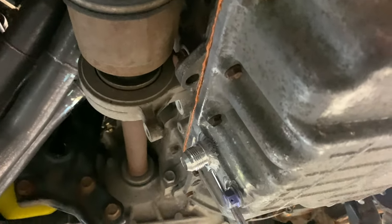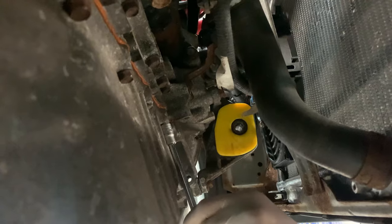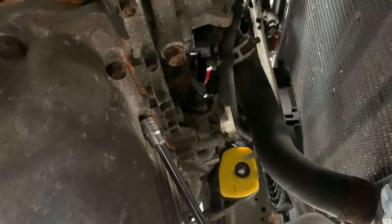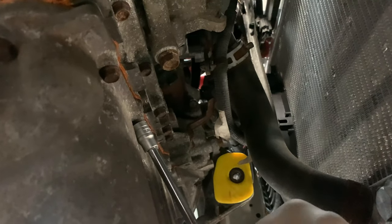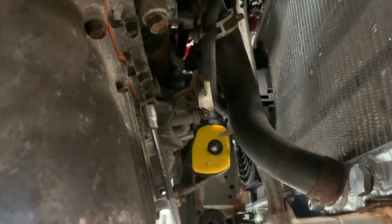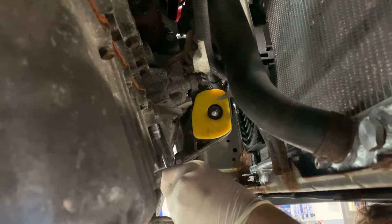There's the torque wrench. We've set this slightly too high, have we? Just by a couple of newton meters. I think about eight to nine is roughly what it should be, I reckon, because they're only small little bolts anyway. So this is set at 10, isn't it? Start at 10 newton meters. This is the lowest set, so 10's all right.